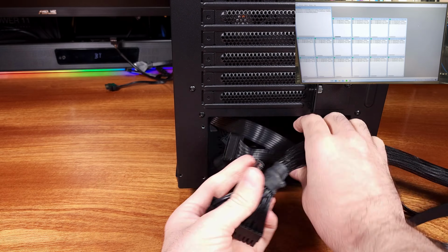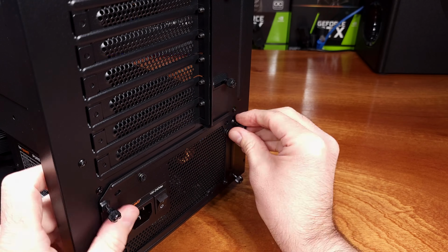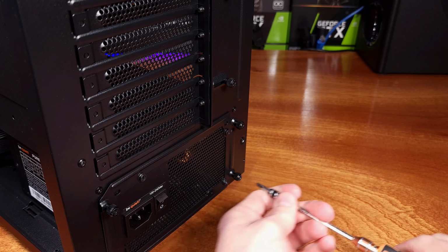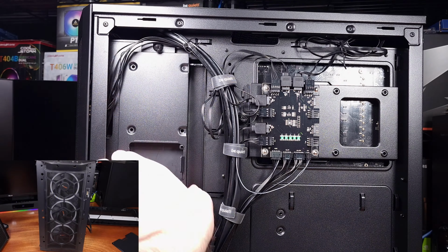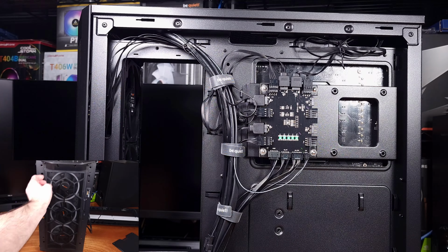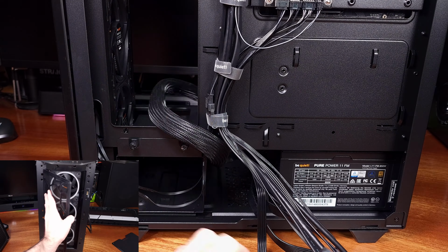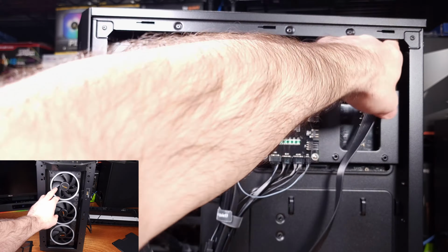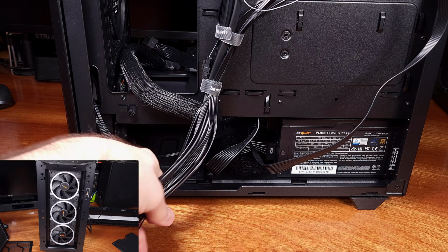5.1 GHz. I initially chose the 70% because I thought that this test would represent the best compromise between total sound output and cooling potential. We can see here that upping the fan speed to 100% did help. We did reduce core temps on the CPU and the GPU, but the provided benefit wasn't really that high. In fact, I would go so far as to say if you had a setup like this, I would probably run this 24/7 at about 50 or even 60% fan speed.